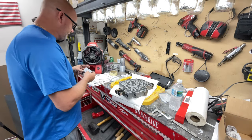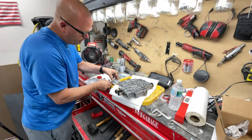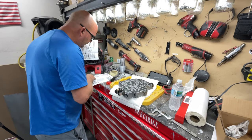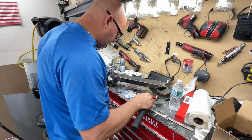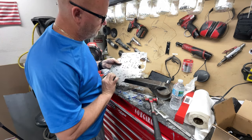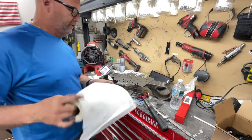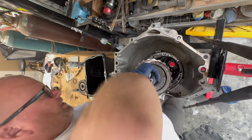Not sure why they didn't do that from the factory — I guess it's to help cut down cost. Here are some O-rings. I'm not sure if the Transgo setup is the same as this — like if it's just an updated version. I see a lot of people running the Transgo, but it's the aluminum plug through orifice with mushroom on both sides — that's what it should look like right there. Now I see why they gave you two of them. That's pretty well smoothed out — hit with a center punch. Let's wipe this thing off one more time — that stops the pump from going down too far.